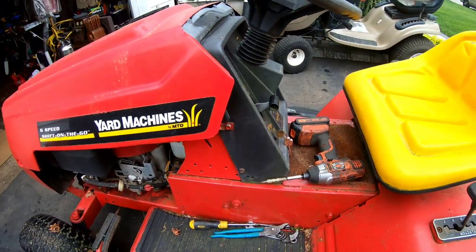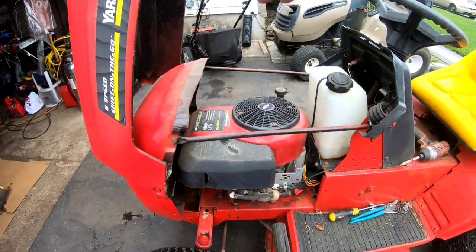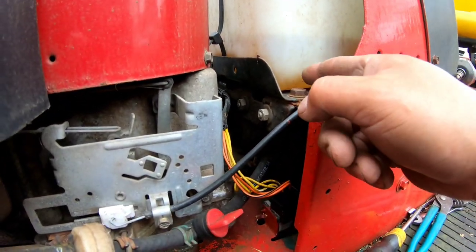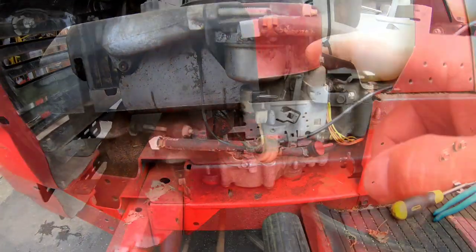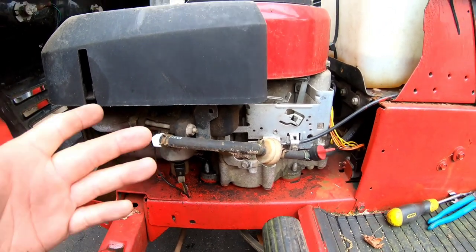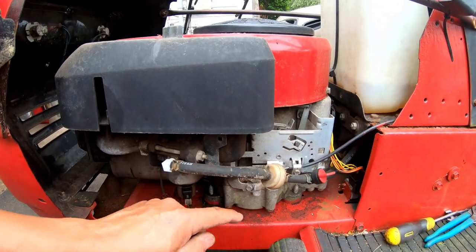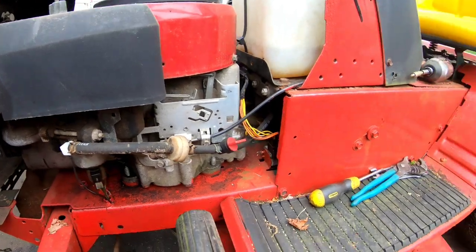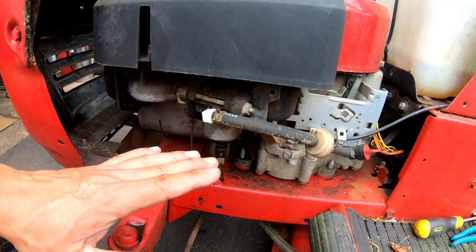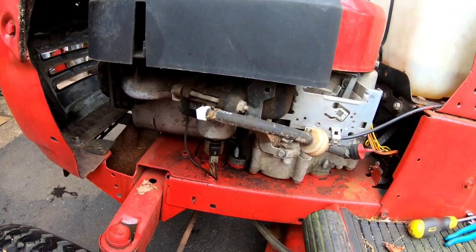So I either have to tap the solenoid or jump it or something. When I poured gas in here, it had old gas in it. I mixed good gas with old gas. Gas started pouring out over here at the carburetor. It hasn't been used in about 2 years. While it was pouring out, I tapped the bowl with a wrench and it stopped. When you tap it, it jars something loose, the float starts moving up and seats, so it's okay now.